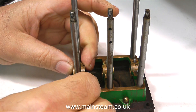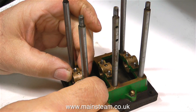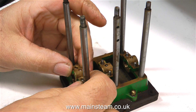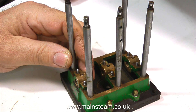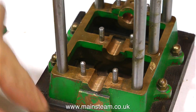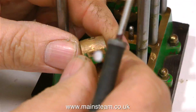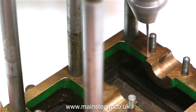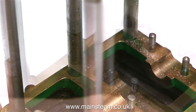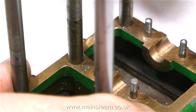Before doing all that, I just need to make sure that these bearing top caps are in the correct place. A couple of them are interchangeable and it's very difficult to see which goes where. What I have to do is try the crankshaft in position on each of them, and that tells me which is which. Once I find out which top cap goes where, I'm making a small mark to identify the positions of these top caps.